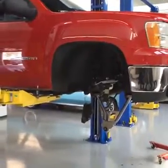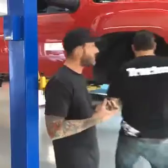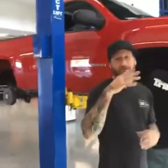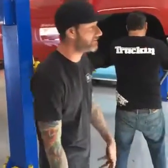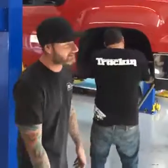A lot of times you'll actually see those little spacers flipped over to compress the spring to try to lower your car. Problem with that is, one, you run out of spring because now you're going to bottom out on that little clamp that's compressing the spring down. Two, it's just not the right way. Spend some money, do it the right way. You're going to enjoy the ride much more, and it's going to last forever.